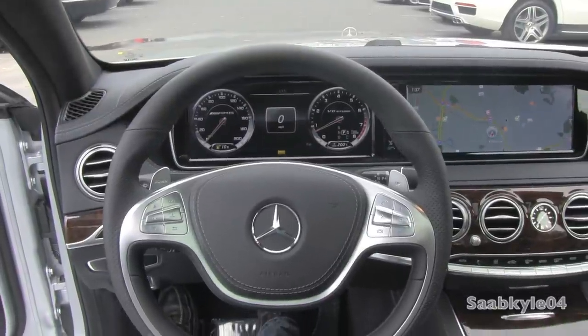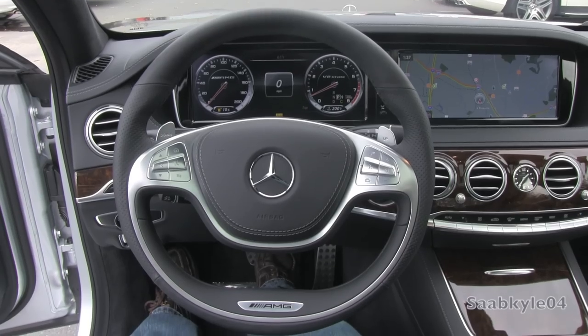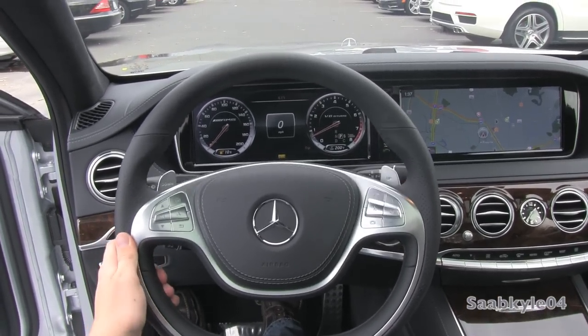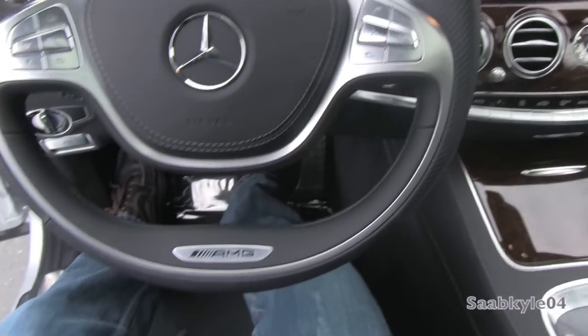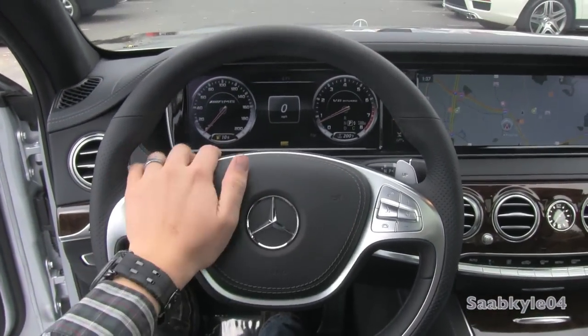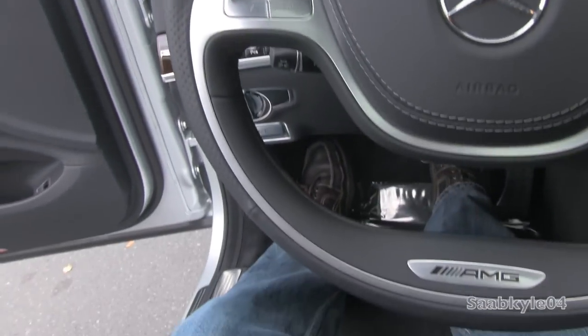The S63 features a new electromechanical direct steering system specifically calibrated by AMG, and a very unique and elegant classic-style two-spoke steering wheel. The steering system allows for a greater efficiency impact, as it only requires energy while being steered. The benefits of a direct steering system is the variable steering ratio, which becomes more direct and responsive over the steering angle. It's sharper at higher speeds and more relaxed at lower.